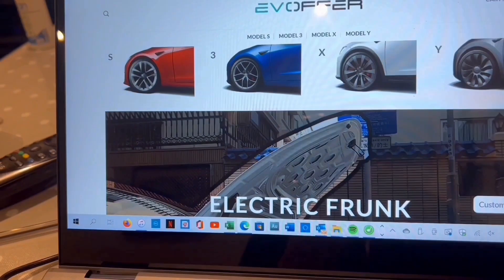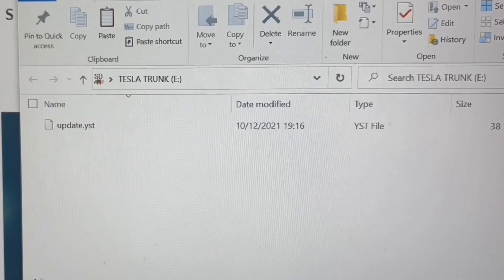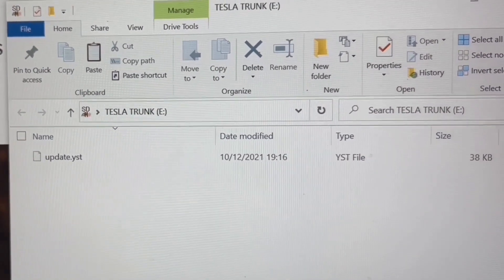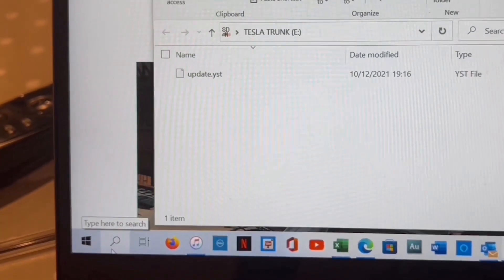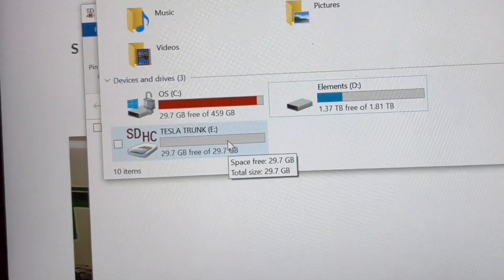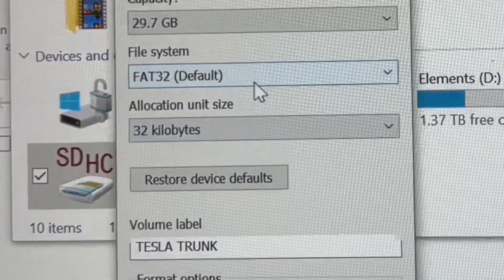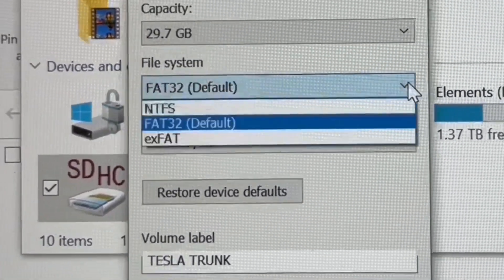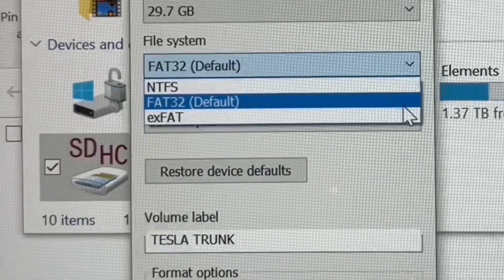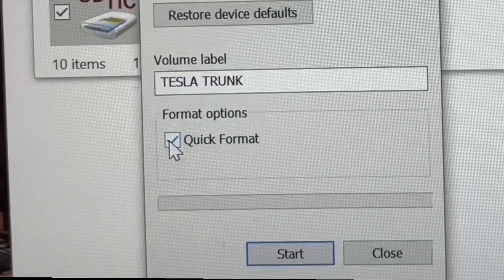For many computers there's a slot where you slide it in and it will immediately be found. The SD card needs to be named 'update_yst'. When you first plug it in, you need to format the disk. Go into the search bar, find 'This PC', right-click the unit, and select 'Format Disk'. In the dropdown menu, select FAT32 — that's what it has to be. If it's exFAT or NTFS it won't work.